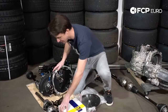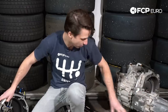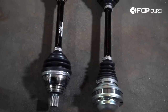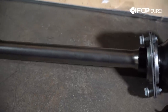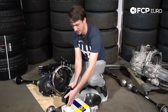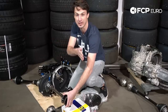One of the things I talked about was the unequal length axles on the DSG — the passenger side significantly longer than the driver's side. This unequal axle length is controlled by the electronic differential on the DSG to stop torque steer. The mechanical way to stop torque steer is to have equal length axles. On this sequential gearbox, the passenger side axle is actually the same length as the driver side axle, achieved by running a center shaft — a very light hollow shaft that mounts on the back of the engine block. This allows the right and left axles to be the same length, distributing torque evenly to both sides and keeping that steering wheel from pulling one way or the other when you get on the power fully.